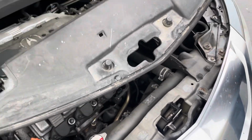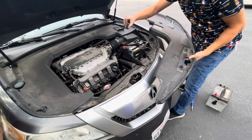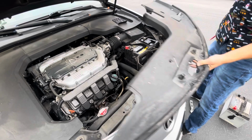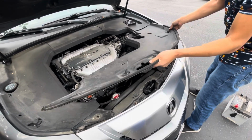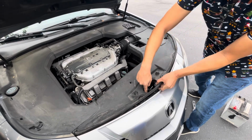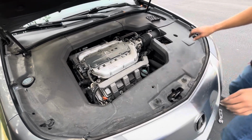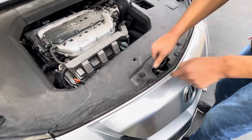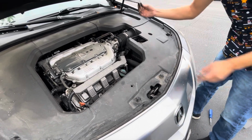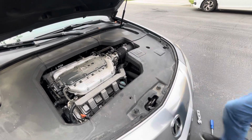All right, go ahead and grab your finish panel. We removed one connector over here, so don't forget about that one. Pop that in place. Okay, now we're going to slide this under the other panels. Don't forget about this hood latch. And these pins, just press down there so that you hear it click in place. That's back in. Reconnect this. That's it.